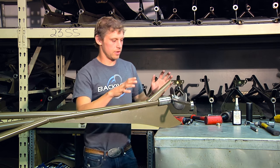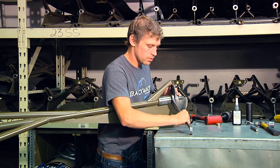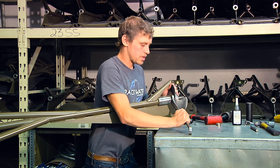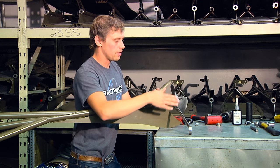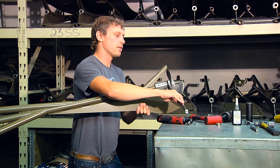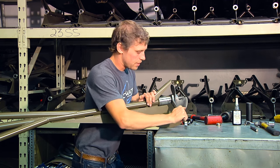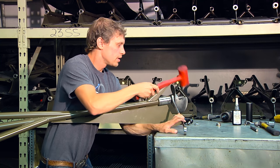Here I have the skeg resting on a solid workbench, and I'm going to turn the shaft so the wrench is also touching this solid workbench. What happens is when I hit the prop with the dead blow hammer, all the energy is transferred into actually spinning off the prop. If it's up in the air, the energy turns into vibration and travels up the long tail. So having everything held solid and tight is key.